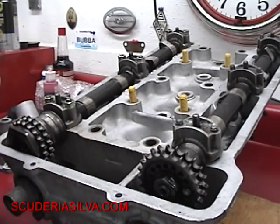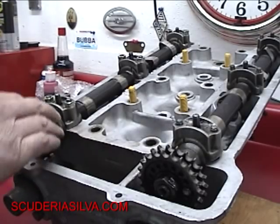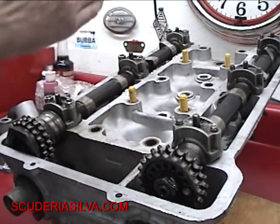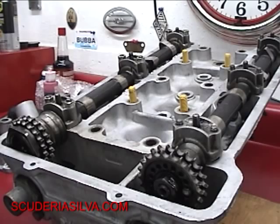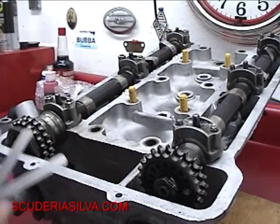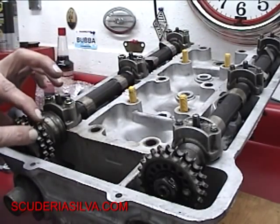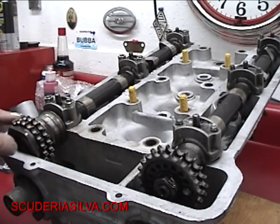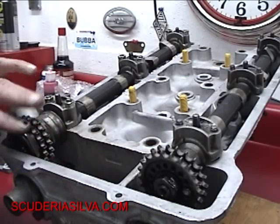You've got to turn the front of the camshaft so that you can measure each valve and make adjustments at the shim. We're going to measure it and make additions or subtractions depending on what the valve clearance is. You know this is the intake cam — not only it's on the intake side, but it's also got the variable valve timing apparatus on the front, the VVT. We'll talk about that later.